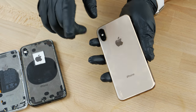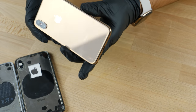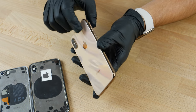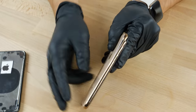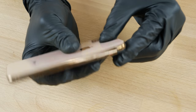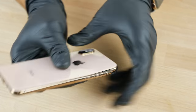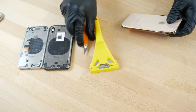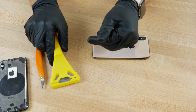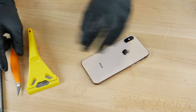So we're going to be taking off this glass, then the camera, and scraping off this entire thing. For the people that do want to do this, I'll show you guys how to. It's quite a struggle, but shouldn't be any more difficult than last year's. So just so you guys can see, I already pried it and broke the seal on the antenna band here, and I can get my fingernail underneath or any of my tools and start prying. I do have my scrapers — really sharp carbide blades. The sharper the better, because Apple has some sort of application process that bonds to glass so insanely well.